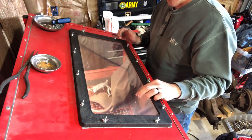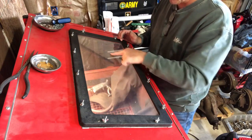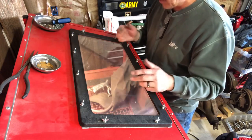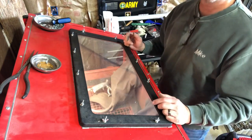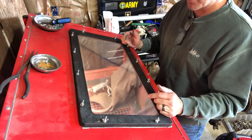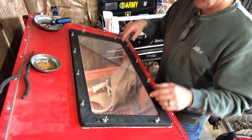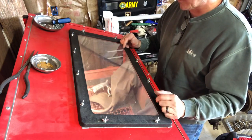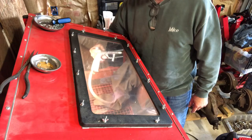Nice and durable. We've got a piece of Plexiglass on the outside protecting it from any chemical spills, and I can see in this box like I've never been able to see before - much clearer than putting the plastic film in there, and we've got that layer of protection on the inside. It'll be interesting to see how long that glass lasts. Twenty bucks - piece of glass, some new hardware - and when you're ready to replace it, you just pull the wing nuts, pull the frame, slap in a new piece, drop the frame, hook everything back up.